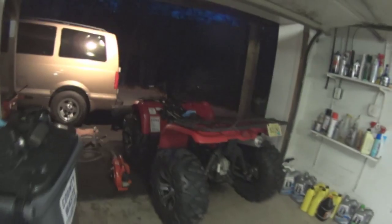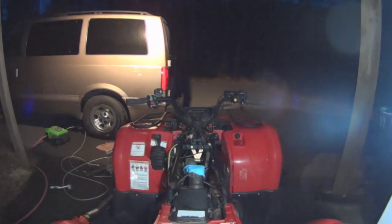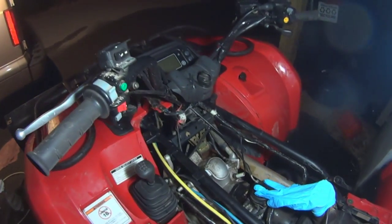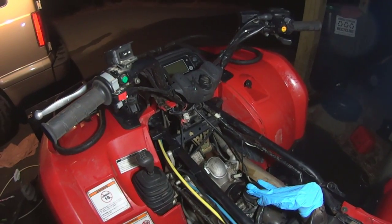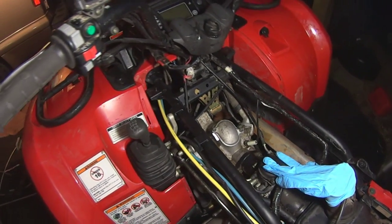It's almost dark — the whole driveway is wet. Now I can pull the quad back in and let it dry a little bit, then we'll adjust the valves. What happens is they actually tighten up as you break the engine in — they get tighter and tighter. When you've got combustion inside, the valve is a little bit open, it's got a gap, and then it blows combustion gases back into the intake valve and ruins them. So it's a really, really important thing to adjust these valves.